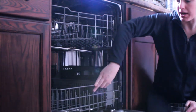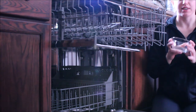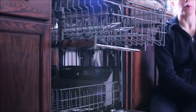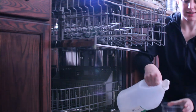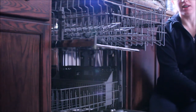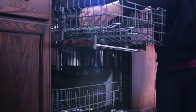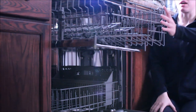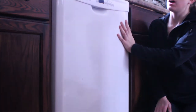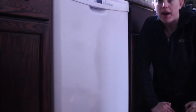Once you're done with that, go ahead and push the bottom drawer back in. For the top drawer, you'll want a dishwasher-safe bowl — I'm using a Pyrex bowl — and then pour about a cup of vinegar in there. It doesn't necessarily matter the exact amount; you just want an upright dish with some vinegar in it. Place that in the top rack, making sure it fits upright and isn't tipping. Close the dishwasher and run it on a hot water cycle, then we'll come back with the next step.